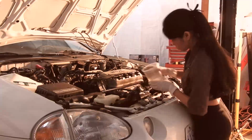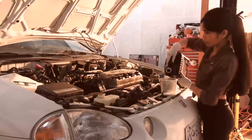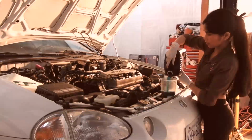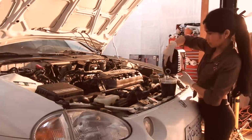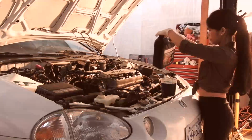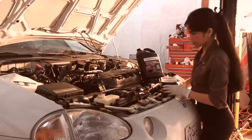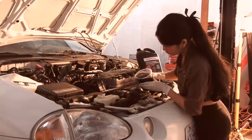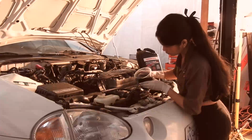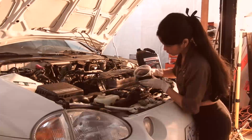And you also want to make sure you really get the coolant into the system and you don't have these air pockets blocking your coolant going in. Otherwise you're going to have overheating problems, and you also have an erratic idle problem, where when the engine's cold, your idle will go up and down and surge. It'll go away when it's warmed up, but those are some of the problems you'll get when you change your coolant on these cars if you don't get the air out of the system. So getting the air out of the system is very important.